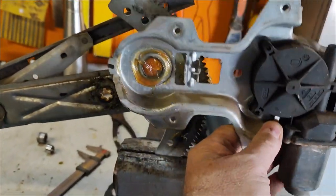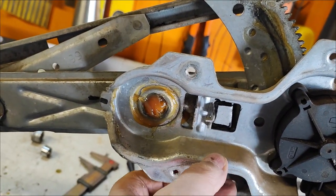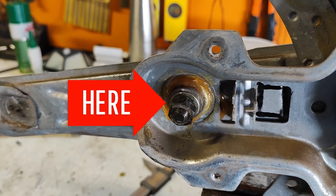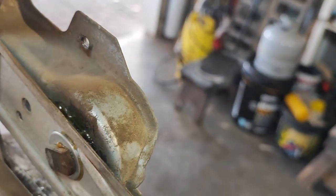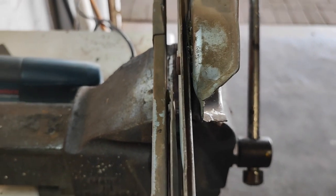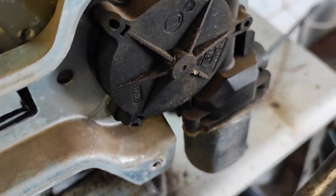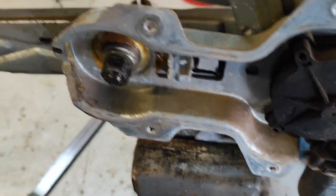There's my grease on all the surfaces. I put that back — we made those marks so we can make sure it's lined up — and I'll get my bolt in. The bolt is in and we've got a lot of grease on there. The center piece of the socket is in there. It's very important that this is not just a normal bolt, because it's pretty close there — it needs to clear that — so there's a little bit of a gap. With the socket in there it has created a spacer, so I was able to tighten this 17mm nut pretty tight one-handed. It's got a spring washer on it.